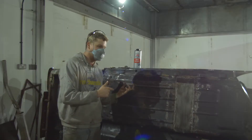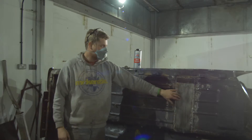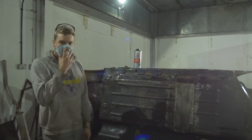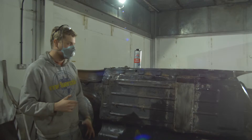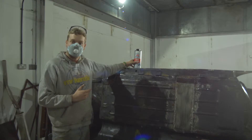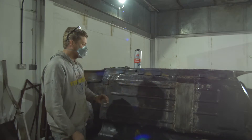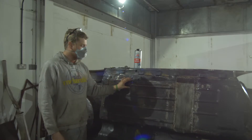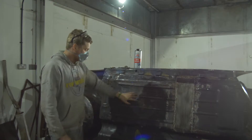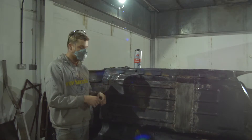It's now the next day. The car has been rolled the opposite way - I've finished all the welding: welded this patch in here, welded in the new outer sills, a couple of patches up here and towards the back. I've got the mask on because I've got the microphone inside but also because it's been a very dusty job. I've had to prep the area because today we're going to underseal the car. I've already done the lower half previously, so now we're on the top.